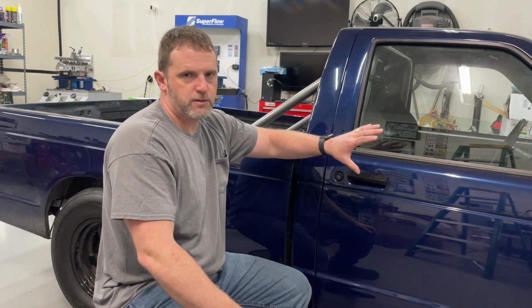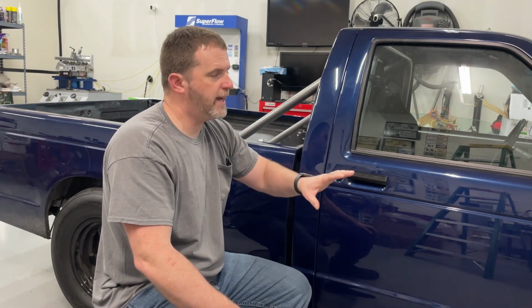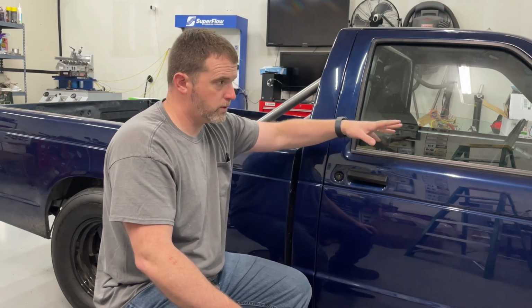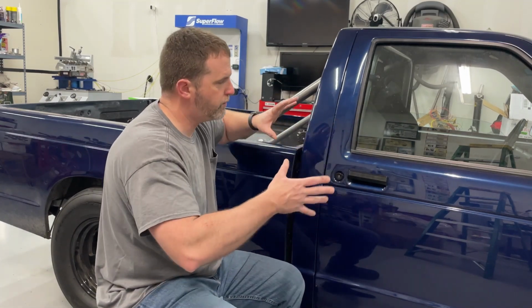And I would encourage most of you, once you got a good piece, good engine that's running well, you've dynoed it and you know kind of what it makes, when you're at the dyno, ask them to give you the uncorrected numbers. Because chances are that's probably what you're going to see in the car. So I want to point that out. And then once you've got that and you got a good piece, focus on the rest of the vehicle to get the most out of it.